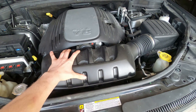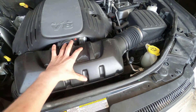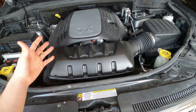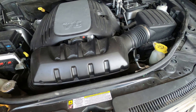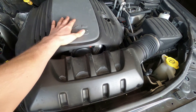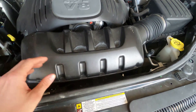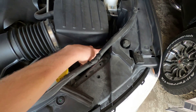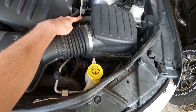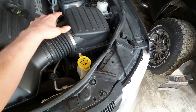So now we're ready to remove the factory intake. We don't like this sound — it's almost like a muffler for your intake system; it reduces sound because people just want to not hear the engine at all. That's not how we roll. So we're going to remove this engine cover — it's just got clips on. We remove this bolt for the hose clamp, and there's a clip down here, as well as snap clips that you just have to pop off. Pull this off along with this hose.